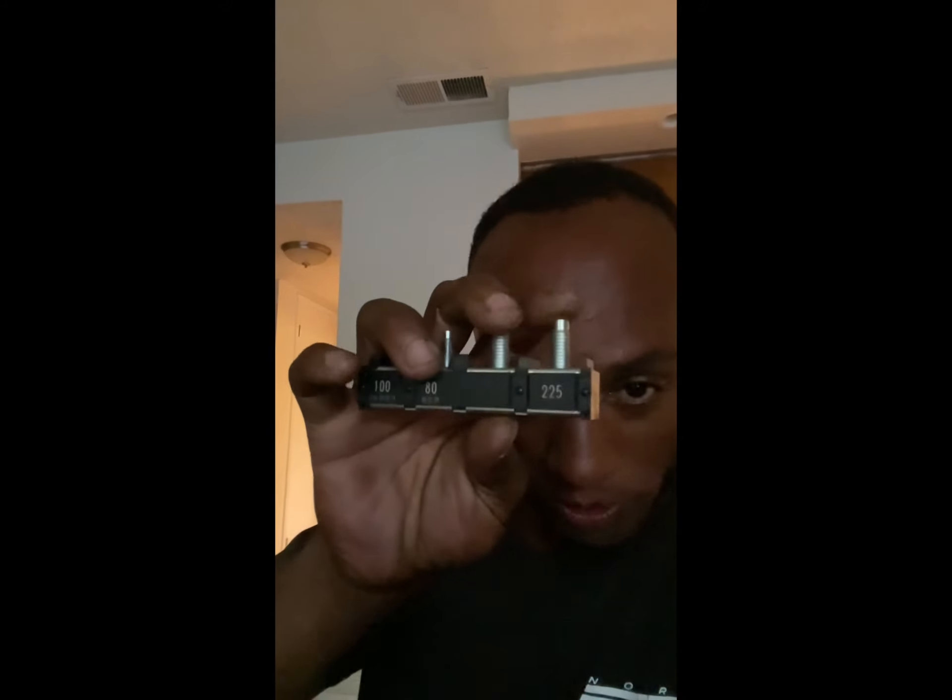Buy this part, put it in, fan works. Disconnect your battery — make sure you do that first before you start working on this. There are two 13-millimeter nuts on the fat ports here and two 8-millimeter nuts on the little ones. The 8-millimeter nuts are attached to the cable, so once you loosen them they're not gonna drop down. The 13-millimeter ones — make sure you have a magnet because they drop into oblivion, and that sucks.